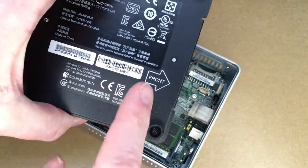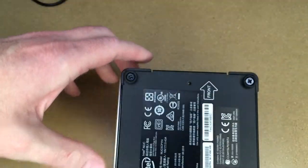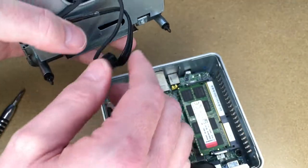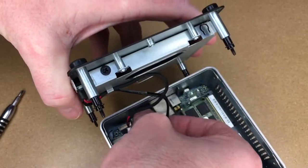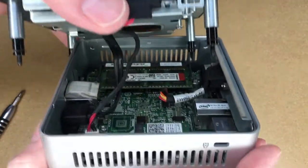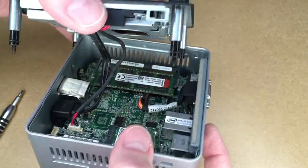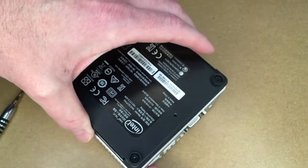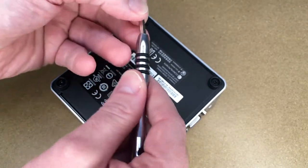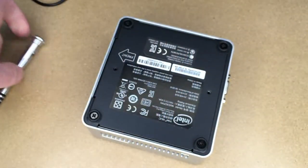Now I want to put the bottom back on. The nice thing about this model is it tells you where the front is — that's where the main ports are. I think some older ones didn't tell you and could go on multiple ways. I'll plug it into the SATA port, then plug the power in — make sure it's the right direction so you don't bend any pins. On the power connector, the red wire is towards the outside wall and black is towards the inside. Make sure nothing is kinked, switch back to the number two screwdriver, and there we go.